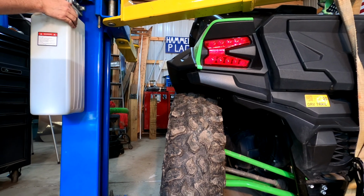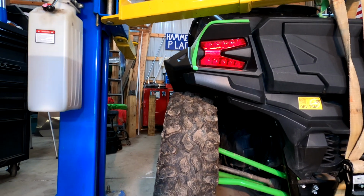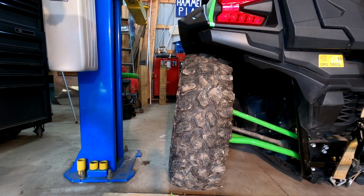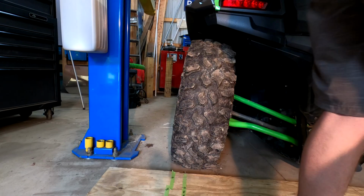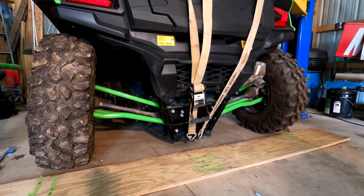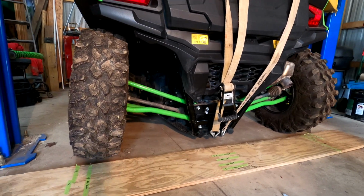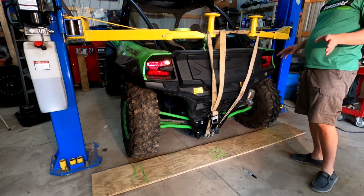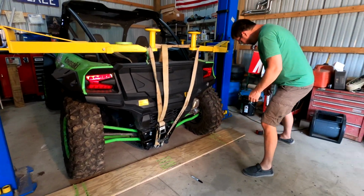The squatting. Top, yeah, see now the top of the tank came in. That is full droop. You do not actually fully bottom out in a KRX. No. We measured that before. So, all right, guys, that's a point you need to make. Yeah, definitely emphasize it. Like in an X3, you can bottom out. It just depends on how you bought it. You do your shocks. The bump stops on these guys are enough to stop you from hitting bottom.